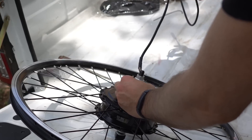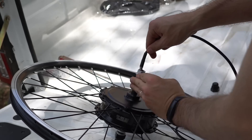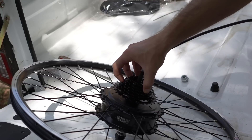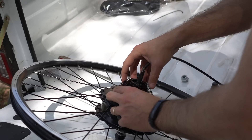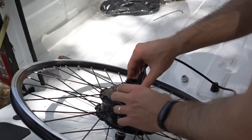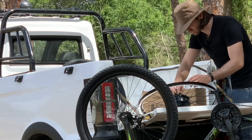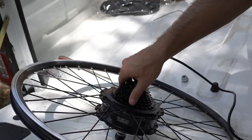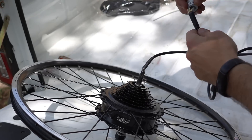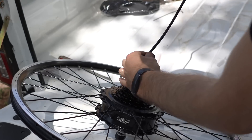From here I've got to slide off all the hardware, just like on the original wheel. You want to be real careful not to cross-thread this thing, so go slow, keep it straight, and nice and easy — there should not be any resistance. It should go on pretty easily. That's going to self-tighten the first time you start pedaling, so you don't have to wrench on it too hard. Now I'll put the hardware back on and the cap to make the axle nuts look pretty.